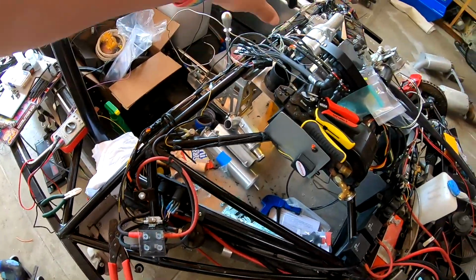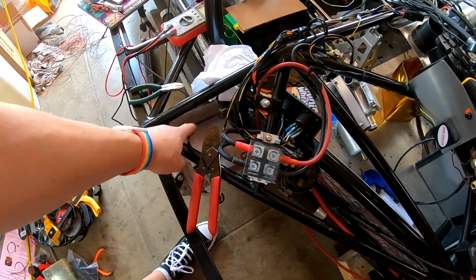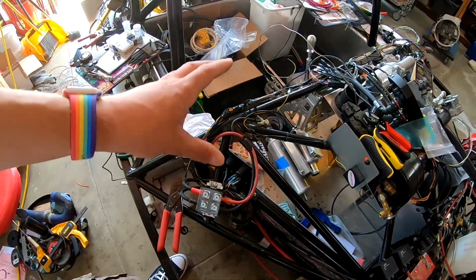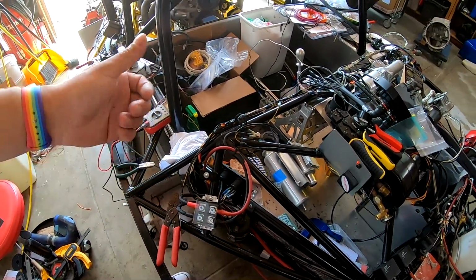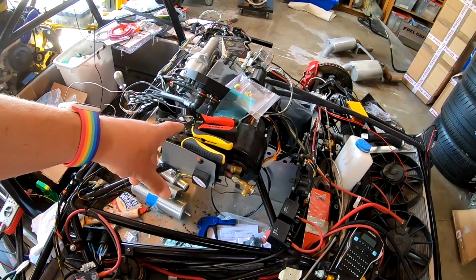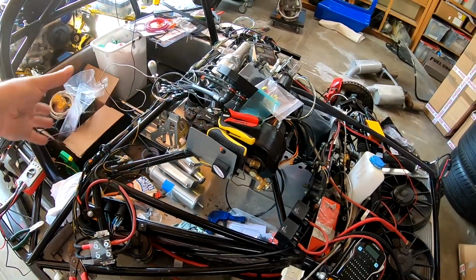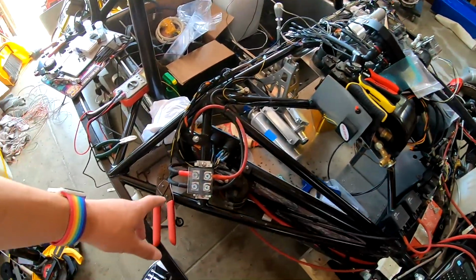And then each of those 3 speeds will enable high, medium, and low on our AC pump, so that it can run at 3 different speeds. Generally speaking, you don't need a high-speed fan and high-speed pump in the Ultima. 2 reasons: A, you have a small cabin, but B, you can freeze the evaporator up here under the dash, which was a problem before,